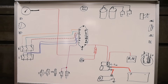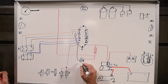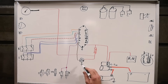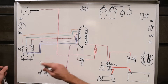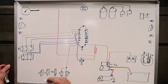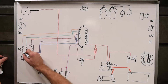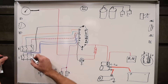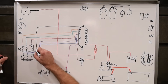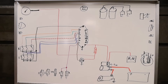The last input is the lock input, and that just goes directly down to the M-Lock. The last thing the M-Lock needs is a ground, so we can throw that in. Sometimes you actually want to carry the grounds to a common splice connection so you don't have to wonder if you've got a good connection to your chassis ground. All of our handlebar switches need to have that ground too — this is an example where all of the grounds splice together and go to a common termination to ensure excellent ground connections.